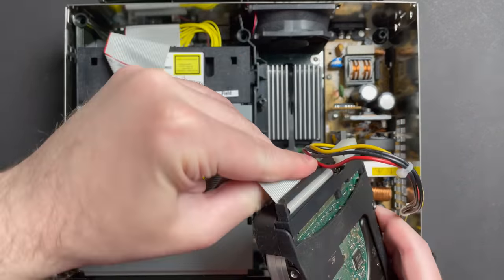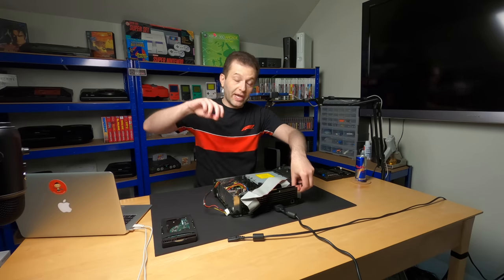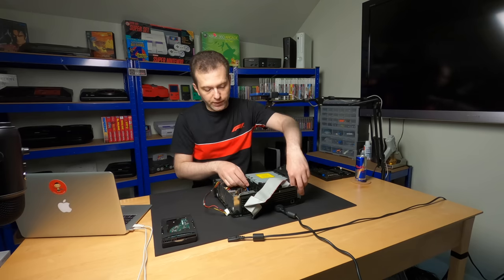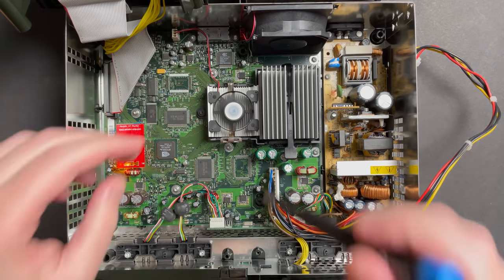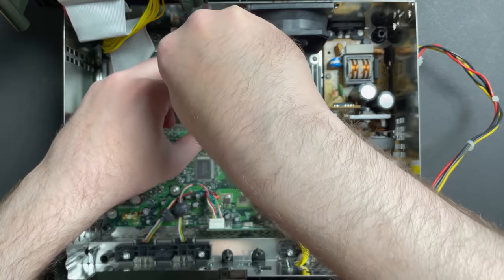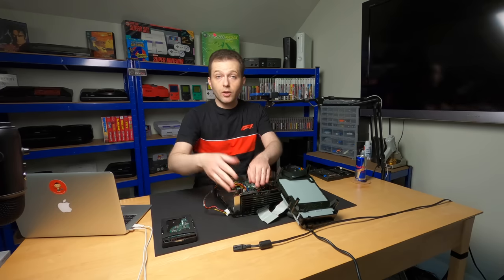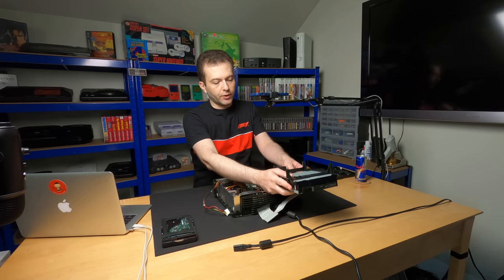Before we do that, let's just take a quick look at that GPU fan and see why it was spinning as loud as it was. I have run into this before when I over-tighten those GPU fan screws on these 1.0 Xboxes, so we might have to just loosen them just a little bit, and it should take care of that fan noise. All right, let's plug this guy back in and just power it on like this. All right, I think that's a lot better. We'll keep an eye on that, but like I said, I've run into this a few times before, and usually it just means that the GPU fan screws are over-tightened.